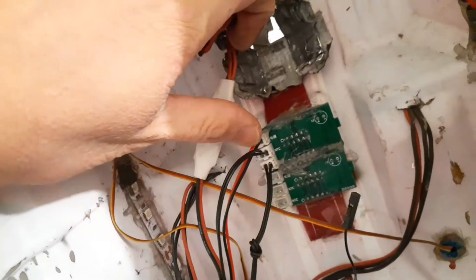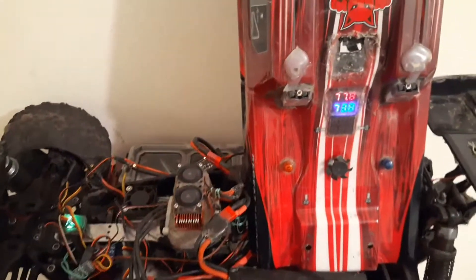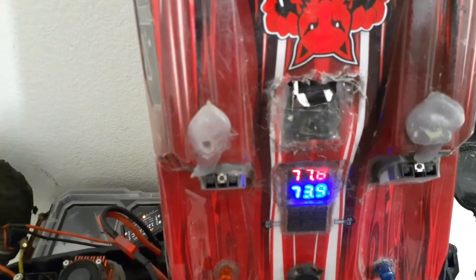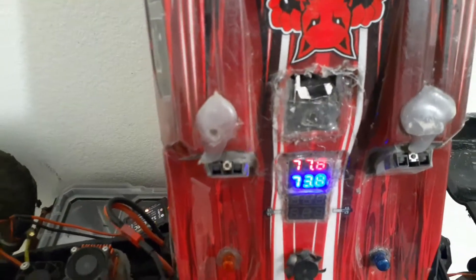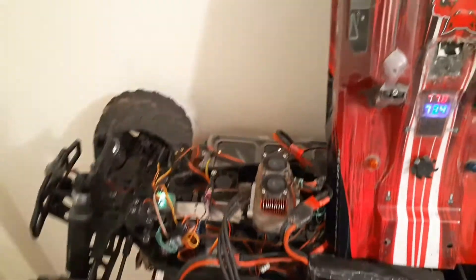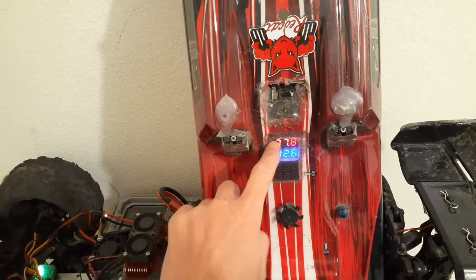Just connect it right here. Power motor ESC. I'm going to turn it on right now. I'm just going to plug in the power, this cable. Okay, I just plugged it in. I had it on for about 5 seconds, maybe 10 seconds earlier, so it should start dropping very soon. The receiver is already on. Now I'm going to turn on the ESC, and then once I hit throttle, the motor will spin and the temperature should start rising.